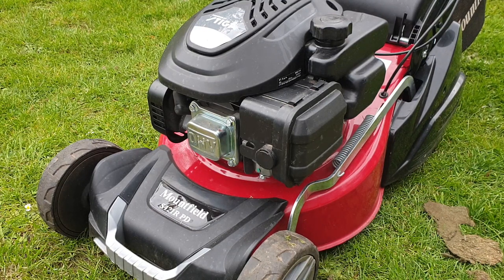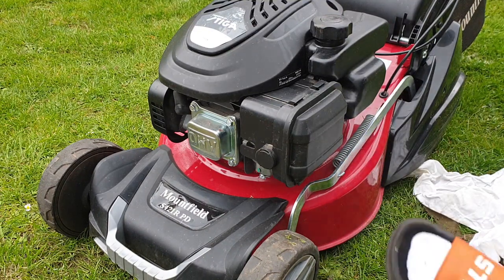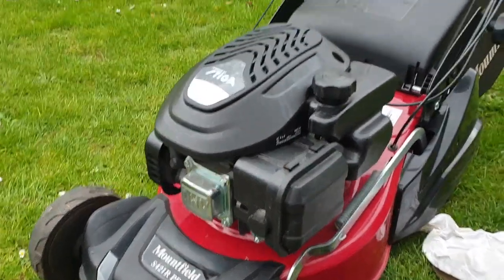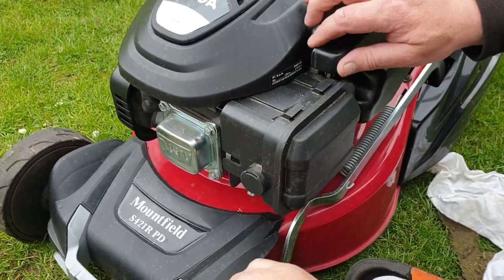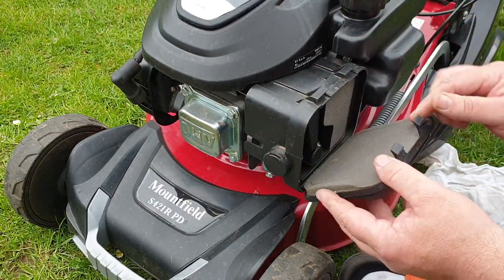If you've got a lawnmower which is being a bit of a pickle to start, then this video could be the one for you. It's going to be a quick down-and-dirty video — I haven't done one down-and-dirty for ages. All we're going to do is get you guys into the shop. HT lead off first, guys. Safety first. You know me — safety first. Air filter off. Good as gold. Two 10mm bolts — whizz them off.